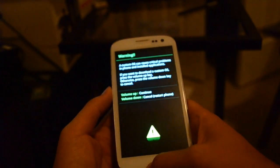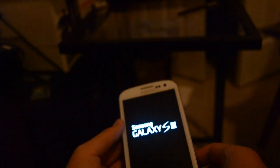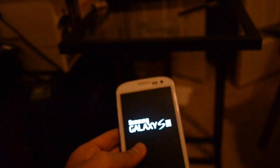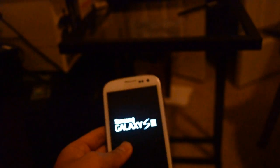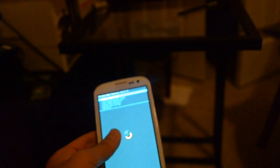I'm going to simply press volume down to restart the phone. Once I restart the phone, I immediately press on the volume up and home key. After you press it, you can let go once you see the Samsung Galaxy S3 logo. When you press the volume up and home key, you make it go into recovery mode.